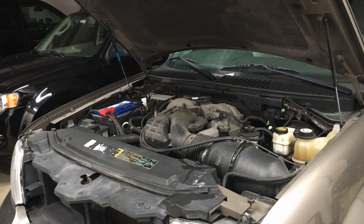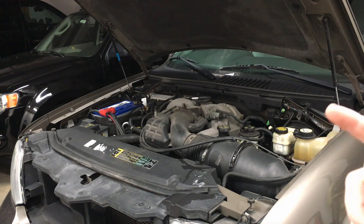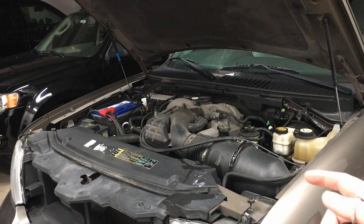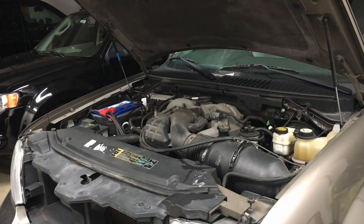Let's go over the vehicle and check it out. This 5.4 liter four-valve dual overhead cam engine has quite a rattle at startup and then also has a chain dragging noise, like a roller coaster chain, whenever it's running. It's been sitting eight to ten hours, so let's go ahead and start it and show you how it sounds on startup.